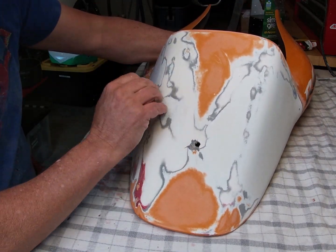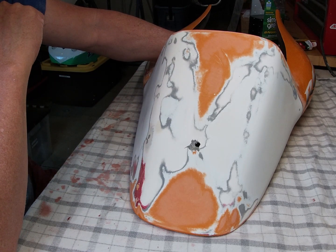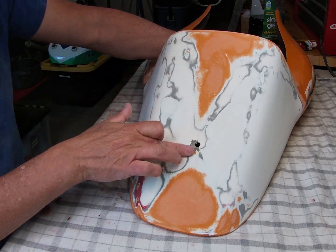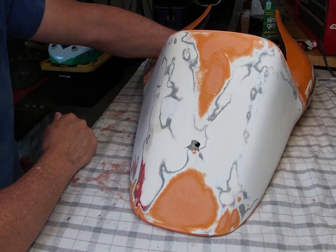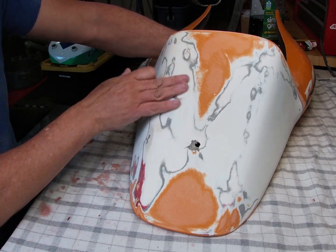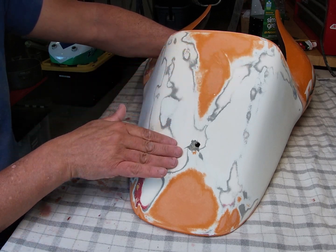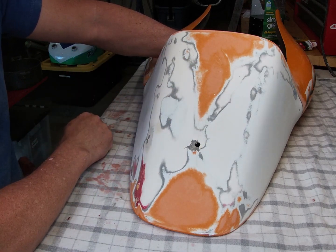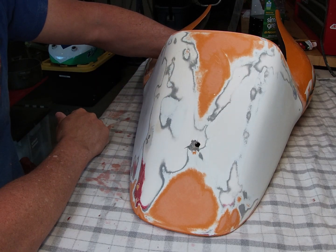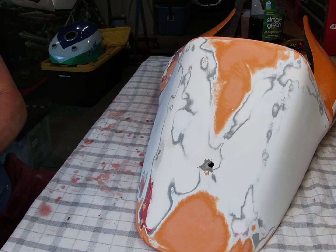On the outside you just can't do that. If I mix up some fiberglass resin and try to lay that in to fix all these cracks and crazings, the fiberglass resin is just not going to wick into these cracks - it'll lay on top and eventually peel off. There's a lot of paint on here, and I can't sand out these cracks because the gel coat is very thin. If I go any deeper than I have already, I risk going straight through the gel coat into the matting.